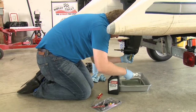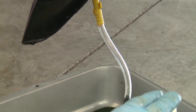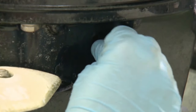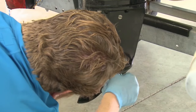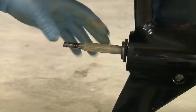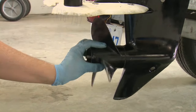There are a number of ways to get the lube in. We're going to use a pump that screws into the lower unit and goes right into the container. Keep pumping in the lube until you see it start to drip out of the vent at the top. Screw the vent plug back in first, and then the drain plug. Don't worry about lube dripping — that's why we put the catch basin underneath — but wipe it all down when you're done.